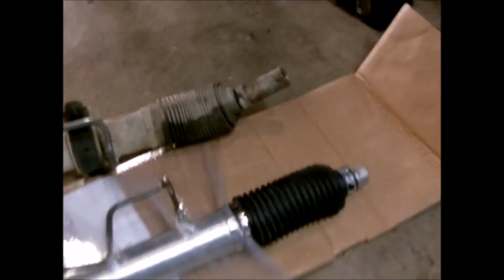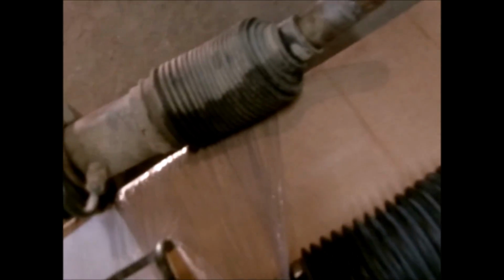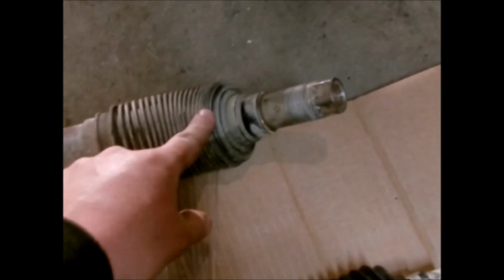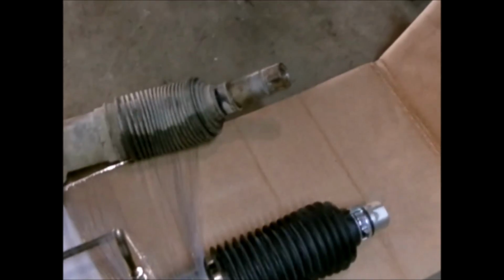And over here, it's a little too dark now under the truck to get the camera to see anything, but basically on the other end of your tie rod you've got a jam nut, and basically a piece of all thread is what it looks like, that's attached to the other end of the outer tie rod end with the jam nut. What I do to keep this fairly close so the alignment's not too far off is I'll break the jam nut loose and back it off about half a turn. And then since this inner tie rod end is a ball and socket coupling, you can actually spin this. It's kind of tight, especially on the new ones, but you can spin this out and leave the outer tie rod ends in place on this one.